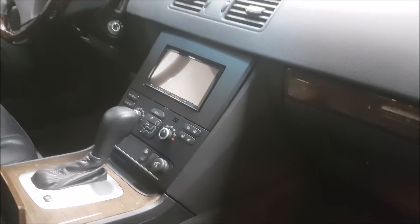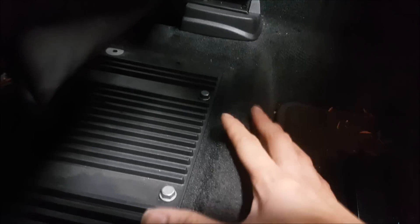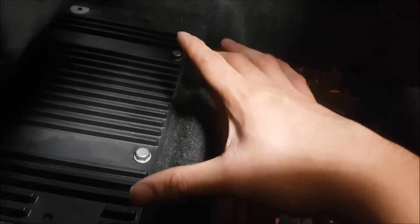The XC90 is interesting because it has a mounting kit, but there is no wiring harness or antenna adapter available for it. So we had to use a universal antenna from Metra — that's right up there. On the other side you can see our Bluetooth mics and the antenna for our Viper. There is an amplifier under the seat, which isn't unheard of, but the way it's done is so nice — three 10-mil screws, pops right out, tons of room in there. I swear these guys are installers.